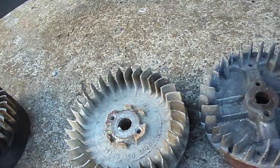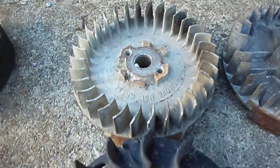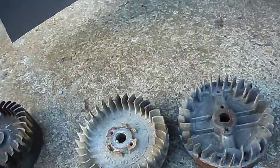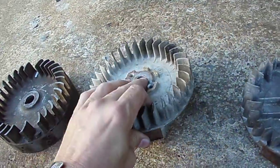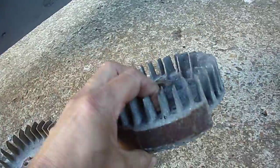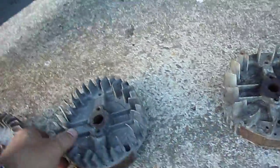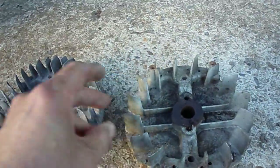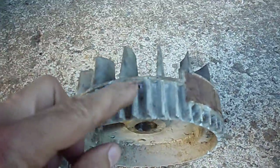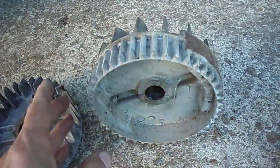See all the fins this old one's got - it's got a million fins, probably three times as many as a new one. So that's the early one from the 50s and early 60s. Then they switched to this one - a little heavier, a few less fins. Then we get up to the 1981 here - it's got a lot less fins on it. And this one has the gear on it for the vertical pull starter. It's also full circle because of the gear.